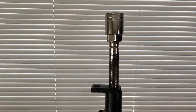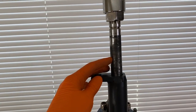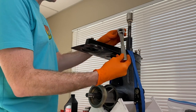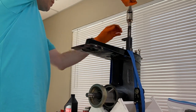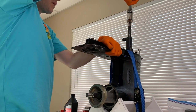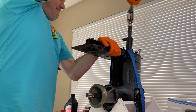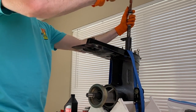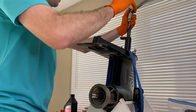Coming up top, I've got that big socket on the spline adapter, and we are not going to turn the retainer nut — we are only going to turn the shaft. No need to rush this step; be precise and patient. I've got my half-inch ratchet, and counterclockwise we are going to loosen that pinion gear nut — it may be on there pretty good. I may need to grab my rubber mallet and give it some friendly taps.